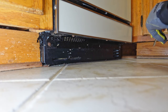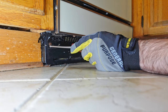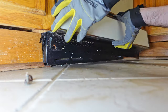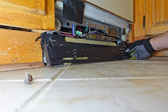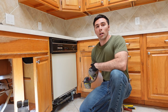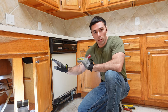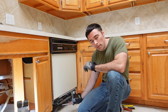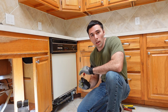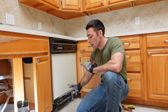I've got no electrical back there that I can disconnect at this time, so I'm moving down to the toe kick underneath the dishwasher. I've got two Phillips head screws that I need to undo to remove this panel and get access underneath. My next step would typically be disconnecting the power cable, but I do not have power access under the sink — there's no outlet and it wasn't plugged in there. Based on what I've seen underneath the dishwasher, the power cord and the garbage disposal run somewhere behind the dishwasher, so I cannot unplug them first. So what I did is I went to the breaker and turned the power off to both devices since they're on the same circuit, and I've already checked to make sure the power is still off.